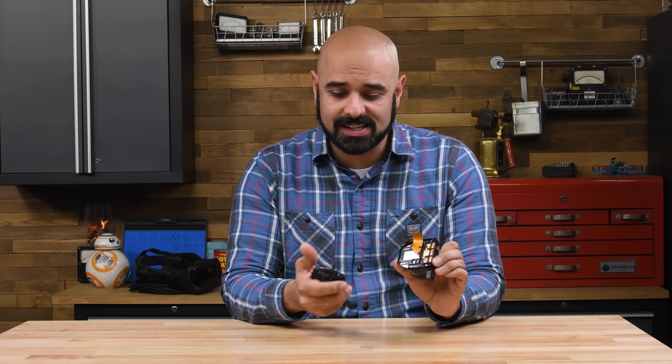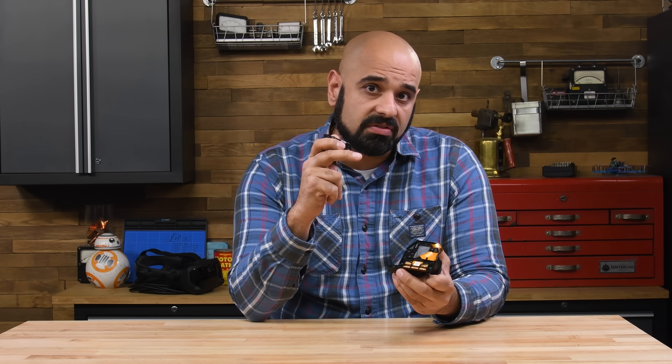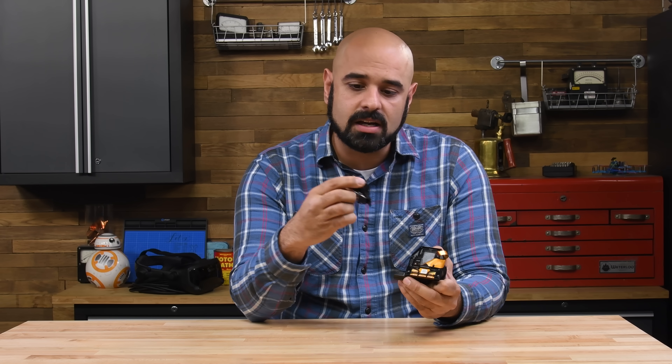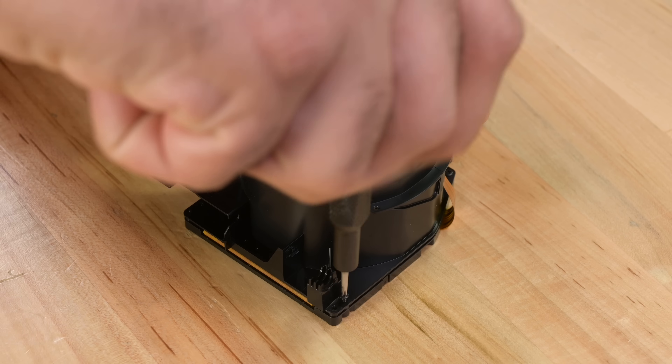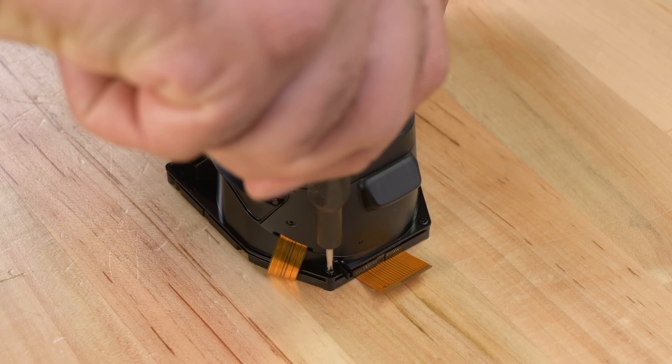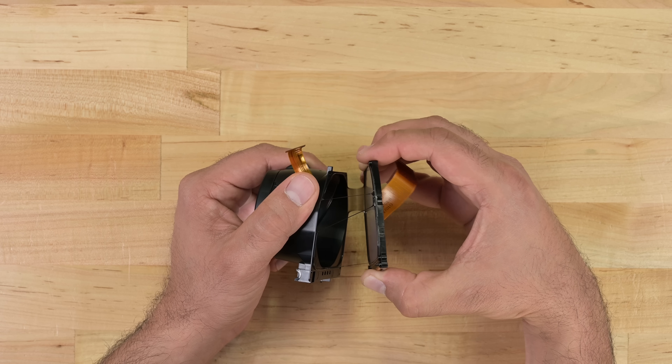So what would a high-end solution look like? It's going to be a combination of high-resolution micro OLED panels — something not present in current generation headsets — together with pancake lenses. That's what it will take to reduce the screen door effect in OLED panels while addressing the size, weight, and contrast constraints of LCD panels. It's worth bearing that in mind when you see next generation headsets coming in at $3,000 and above. With the PSVR 2, Sony has chosen nominal resolution and high-contrast OLED screens to compensate for cheaper Fresnel lenses.